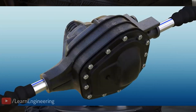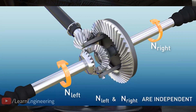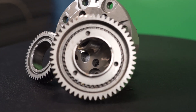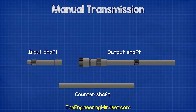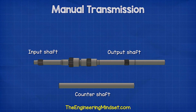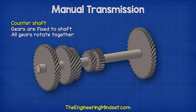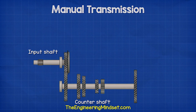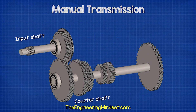Today what we have in front of us is some gears out of one of our SI transmissions. The basics of gears are they're going to be inside the transmission — you're going to have an input shaft side and an output shaft side of the gearing set. You'll have an input shaft and a gear stack, and each part of that stack is going to have different ratios on it. That's a simple way to jump into gear ratio and what that means: it's the teeth on one gear in comparison to the teeth on the other gear — the relation between the two gears of either being under-driven or over-driven.